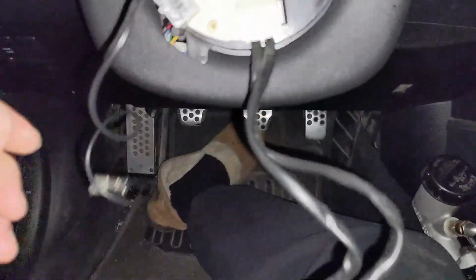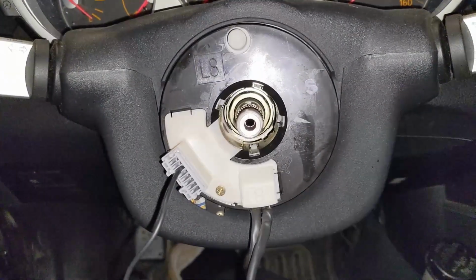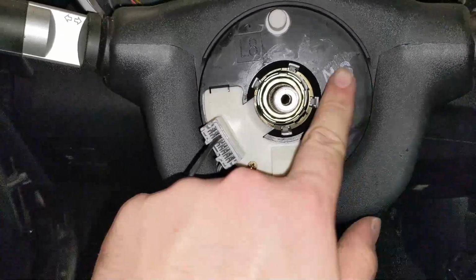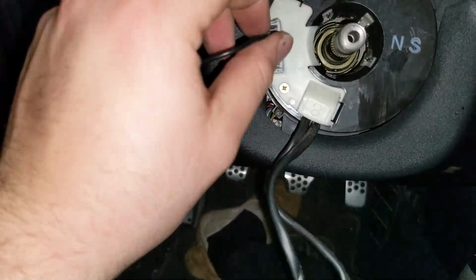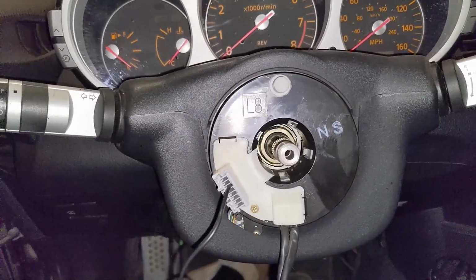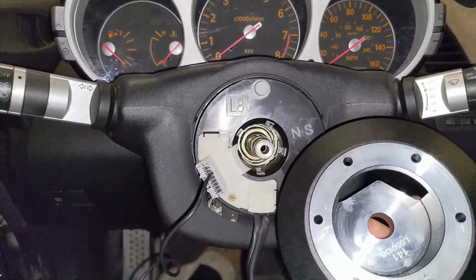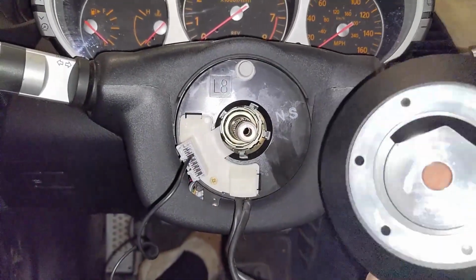One thing I am struggling with, maybe I'm missing something. I'll do some digging around. Since I didn't get a quick release, I'm doing quick release because I don't want the wheel to kick back too far. And I just don't have that F-boy status yet. I need some more hot boy wheels. What I'm going to do for now, though, I need to find a ground. The quick release comes with a little grounding plate, and the hub doesn't come with that plate. So I'm going to figure out a way to ground it out if it looks like I can do it cleanly. Anywhere on here, honestly, I could ground out anything metallic, so I might be able to find a trick way to get on here.